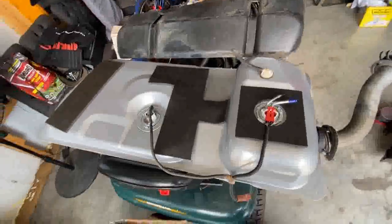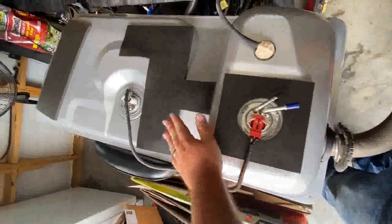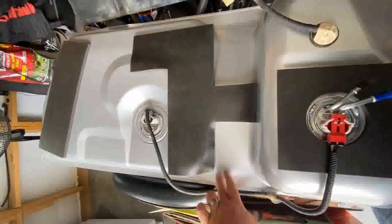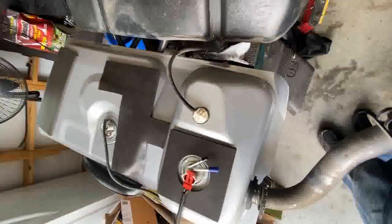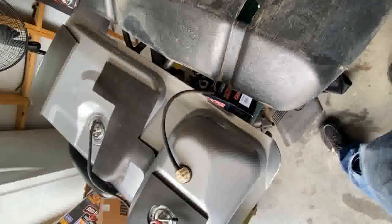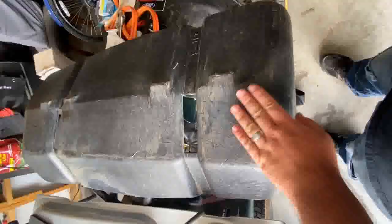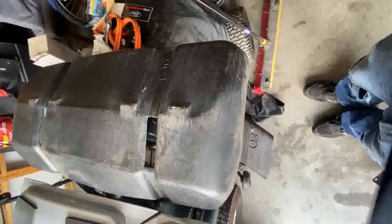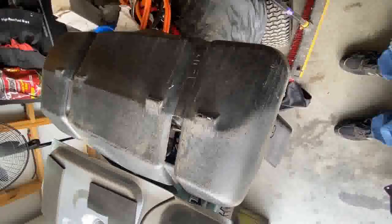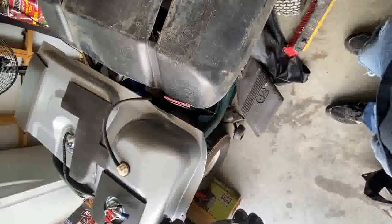Here's our fuel tank setup. We've been holding on to this one because we were waiting on this padding to arrive. It seems a little silly to wait on padding to put a fuel tank in, but it's necessary — you don't want any rubbing against the body, and you definitely don't want metal-on-metal contact, especially where rust can happen. We also have our plastic tank protector. It's cleaned up as much as it's going to get, so it's time to throw everything in.